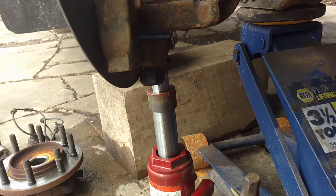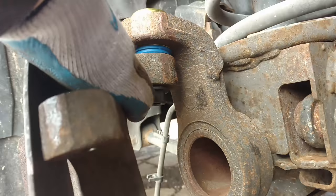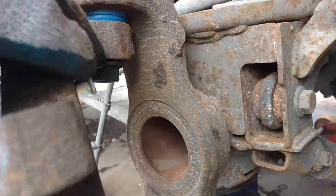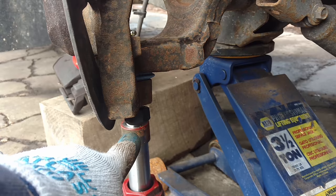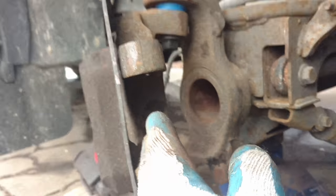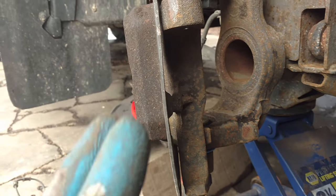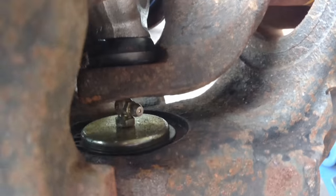Here's a little trick that I do: we know that this ball joint goes into a tapered shaft and we don't want it spinning. So what I do is put a bottle jack underneath the knuckle to put force up, and it basically pushes it in tight, hoping to stop the ball joint stud from spinning inside the knuckle. This way it gets tight right away. This one I'll impact on because I can get to it; the top one I'll have to use my long half-inch ratchet. I turn the knuckle all the way to where it's going to want to turn anyway, up against the stop, so when I put the jack underneath it it's not going to move and the jack won't kick out.